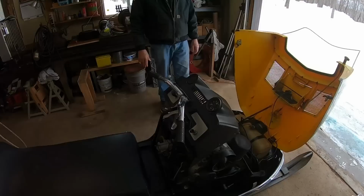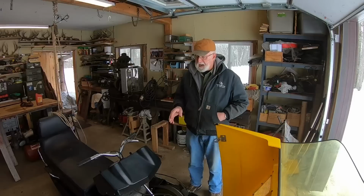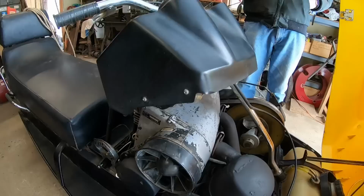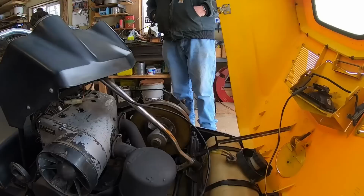What happened, I think, the guy, there was a Union Carbide sticker on here for synthetic oil. My experience back in the 70s with synthetic oil, they set over the summer, they froze up, and I have never in my life torn a two-cycle Rotax down that was froze up as tight as this one was. I had to virtually beat the pistons out of it. Because it was actually like brown rusty all down the piston skirts and everything, wasn't it? Black. Yeah. Black, crusty, rings were froze in.